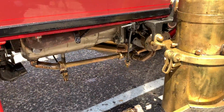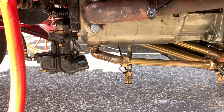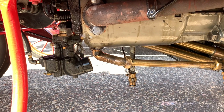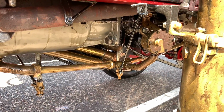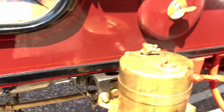Dive in a little deeper here at this last Buick. This is a big twin, an opposed twin. Notice this is all directly underneath the passenger cabin. Carburetor, wide open, no air filtration. Everything just hangs down low. Everything's leaking. Crazy.